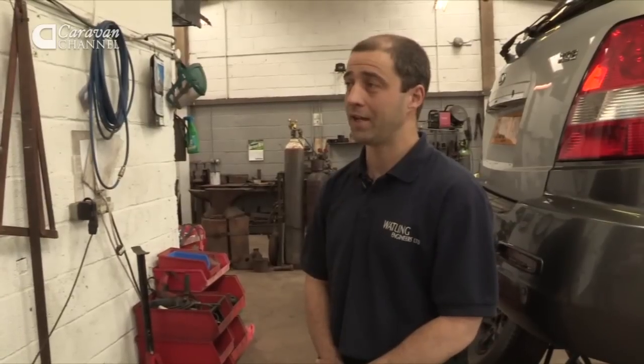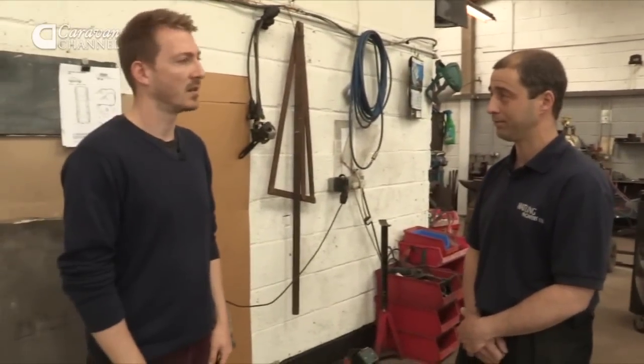There are a couple of different options you can have with tow bars. There are fixed tow bars and there are detachable tow bars. Fixed tow bars are permanently mounted onto the back of the vehicle and are not easily removed. Detachable tow bars have a quick release system, which means that when not in use, you can remove the neck of the tow ball — so you won't shave your shins in the car park, or if you have parking sensors, it enables them to work when you've not got anything attached at the back. My Sorento does have parking sensors and I value my shins, so I'll most likely go for a detachable.